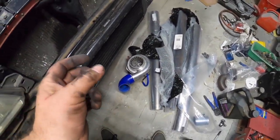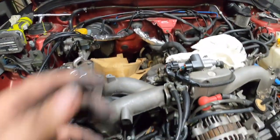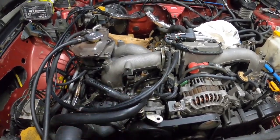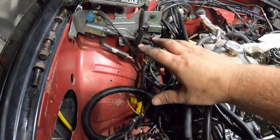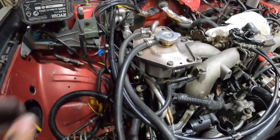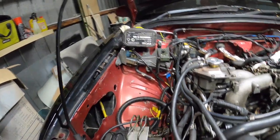It's starting to go. Alrighty guys, so we've pretty much got the orientation set up for the GT35 up the top here. So a bit of an angle, 45 degrees, so we can get an intake through here. The charge pipe will be coming through here. It'll be a 2.5-inch pipe coming through and entering the inner guard. Front of the GT35, most likely into a box, where I have a filter in there, and I'll probably try to get some cold air from the front here, going through this section here, and into it.